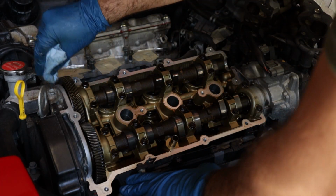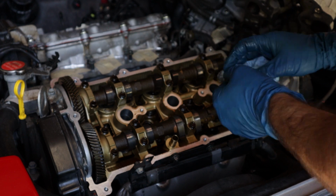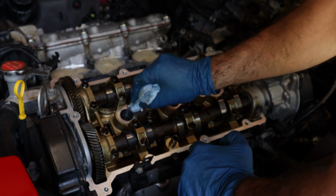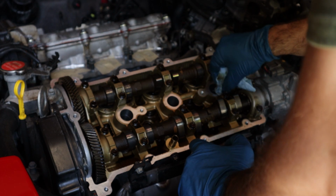Inspect the rim of the engine where the valve cover previously sat. You'll want to wipe away any oil and then clean it off with a rag or a shop towel soaked with brake cleaner. Pay particular attention not to get any dirt into the engine and remove any old gasket sealant which may be present. Do the same for the rim of each spark plug tube.